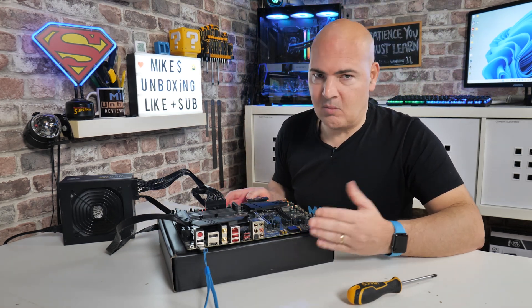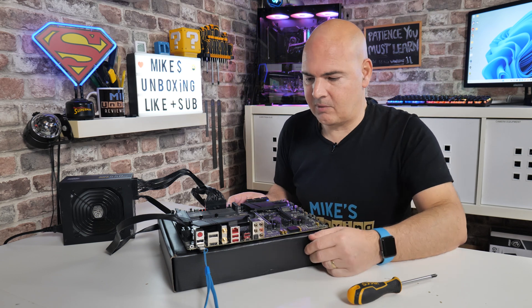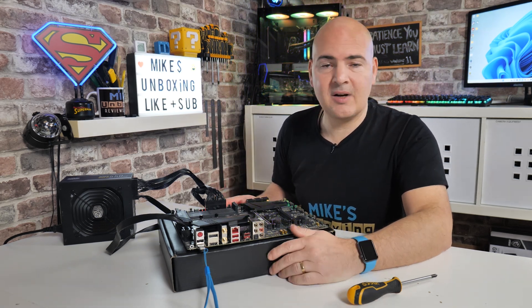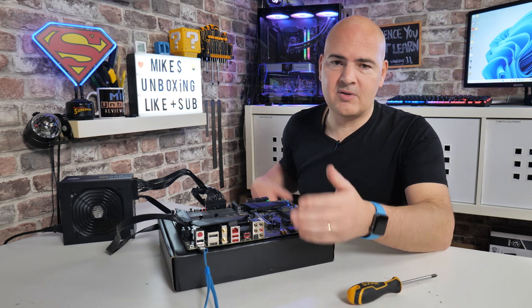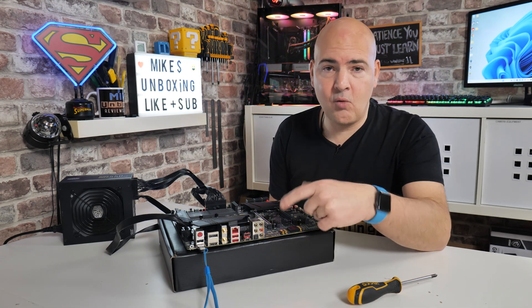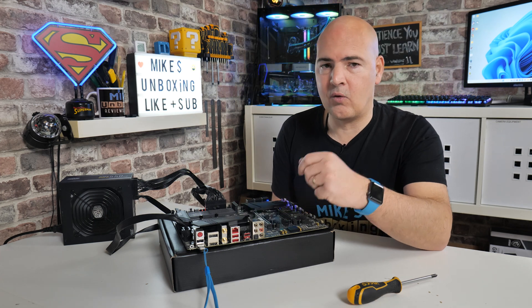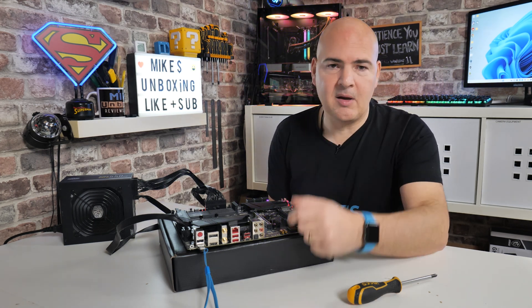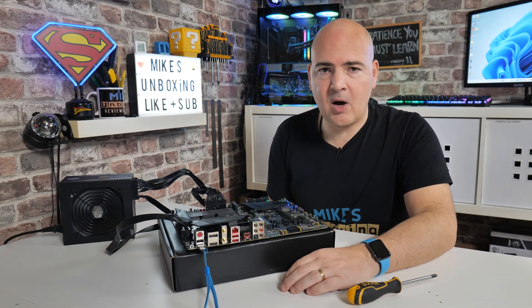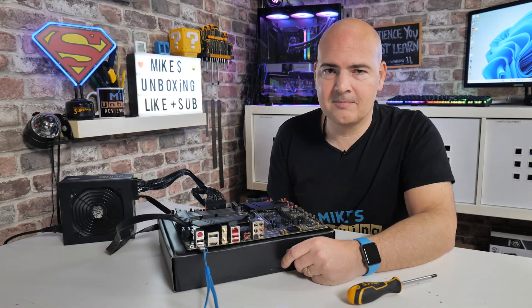At this point you can install your CPU, install your RAM, put a cooler on, and attach an HDMI or DisplayPort connection. Make sure you get an output before doing your full assembly if you haven't already, or if you have fully assembled it, now is the time to test it all out. When you go into the BIOS, make sure you set things like XMP settings and Secure Boot if you're installing Windows 11. There will be a full BIOS tour on this motherboard coming out shortly on the channel covering various settings and APU tweaks. Hit the subscribe button and the notification bell. I've been Mike, this is Mike's Unboxing Reviews and How To — hopefully we'll catch you in the next video. And if things go wrong, you can join our Discord. Thanks for watching.